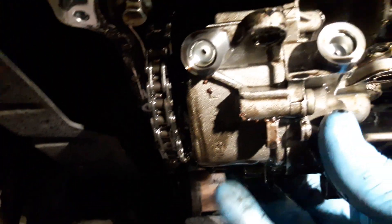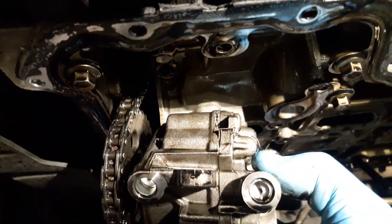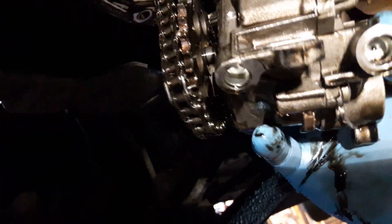The oil pump is loose. There's no need to time this vehicle up — there are no special precautions to take. It actually falls down out of the sprocket, as you can see it's dropped down enough. You can get around this side and just loop the chain off.